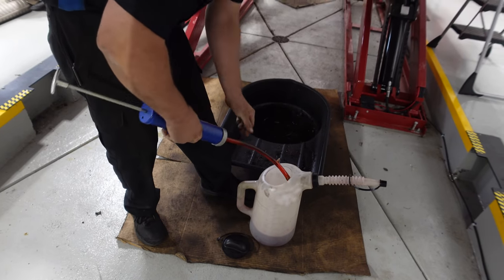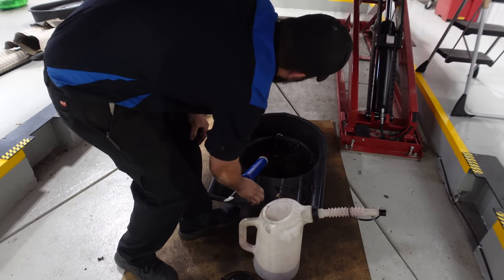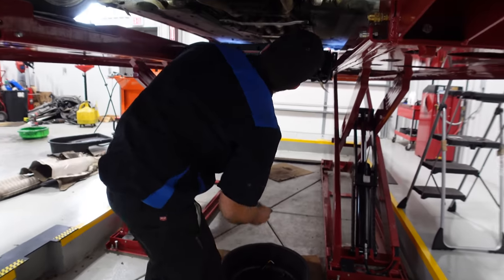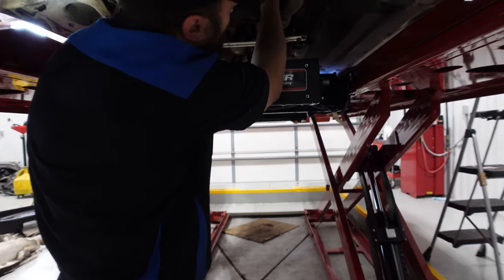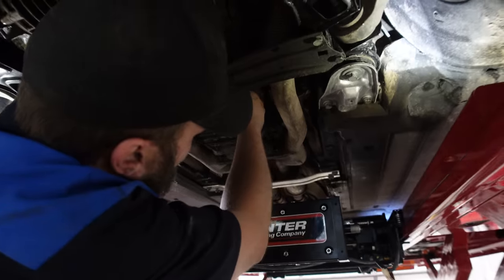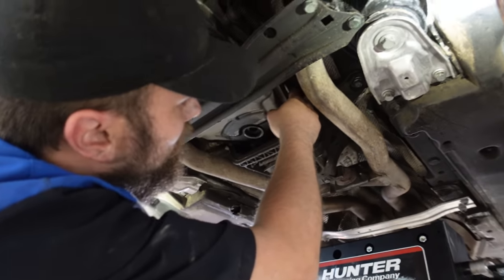Last night I had a hood open warning too. Really? Yeah, it was driving me nuts. I was like, the hood is closed. I checked it over and over. It turns out the wires on the sensor, the insulation had degraded. So I taped over it and it was fixed. Oh, nice. Yeah. I made new insulation.